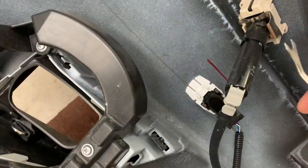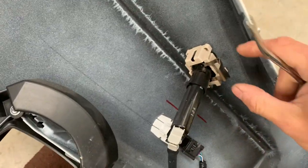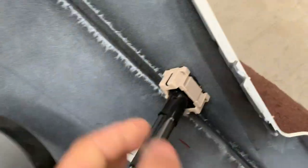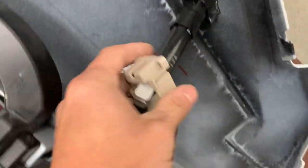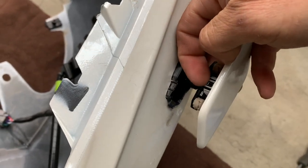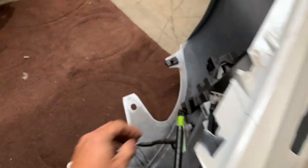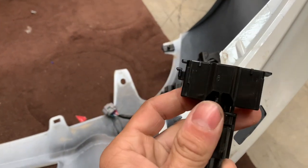Let's pull this one out. Up goes the clip, that can come off, and slide that clamp down and take off the hose. From above, pull it out slightly — you see that top bit, just lever that off. It comes out, then squeeze it from underneath and out she goes.